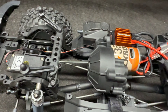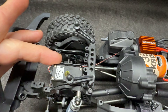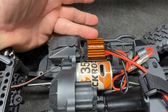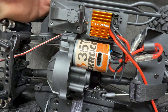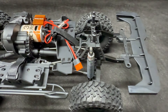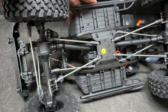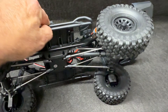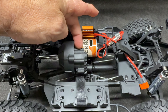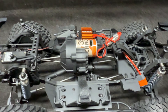Let's kick this off with the chassis. Got the metal panhard mount right here, oil-filled shocks, 25-spline servo, receiver ESC — glad to see these two are still separate. That's a 40-amp ESC. Slick Rock 35-turn motor — that's something new I haven't seen before. The rest of the truck is pretty much standard issue 10-3, which is awesome because there are parts everywhere in case you break something. Overdrive, underdrive, portal gears. You can also change the transmission gears inside to work with straight axles. So a proven system right here.